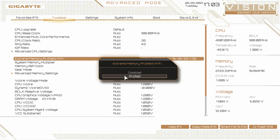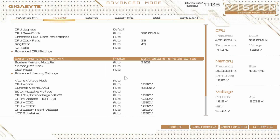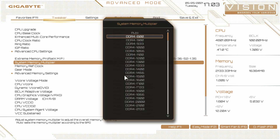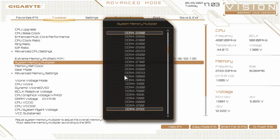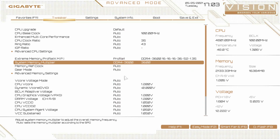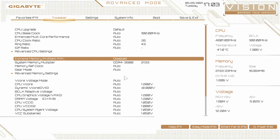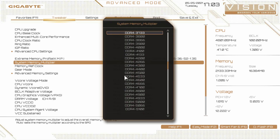Your XMP profile settings are here as well. By default it's disabled — if you want to enable it, you just do that. If you didn't do it in easy mode and you wanted to overclock your memory past 3,600 megahertz, you just go into this menu and set it to what you want — maybe 3,700 or 3,800 megahertz — then save it and see if your overclock works.